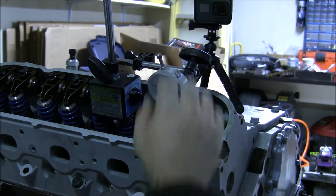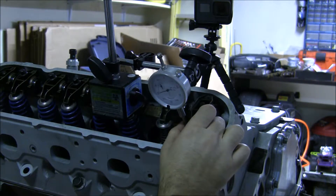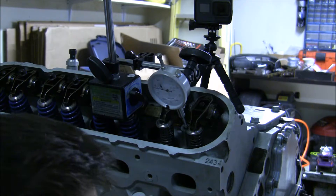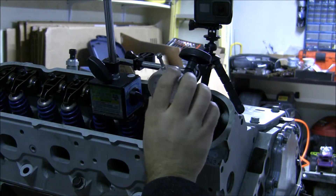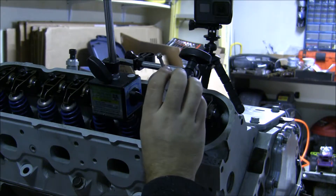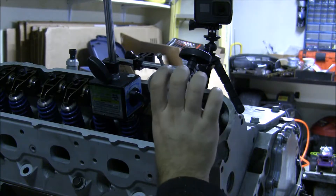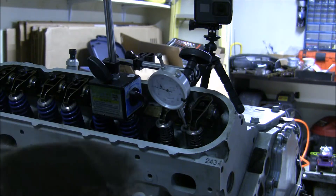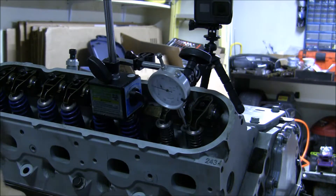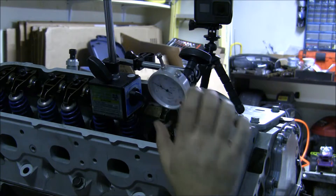Alright, so I've rearranged it to put some tension on it so you can kind of see. Hopefully that will give me enough to bring the valve down all the way. I'm going to zero it out again. The book says to get it as parallel to the valve retainer as you can, but I'm running out of room on my base here, so it's just going to have to fly for right now. I'm going to zero it out. There we go. Now I'm going to press it down and see how far it goes.